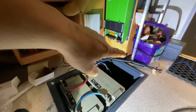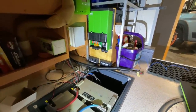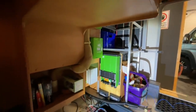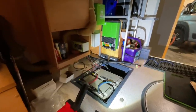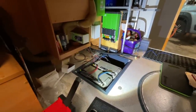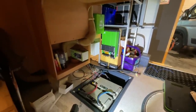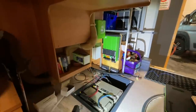All the old stuff flies out. You can see we've already pulled all the new cables through — for the inverter, so we have the new cable routing in place. Then the booster needs to go down through to the alternator and starter batteries. Then the solar controller, because we're building a completely new solar system on the roof. We've decided to do something really good for the customer: he gets 350 watts on the back of the roof. That'll be really great — with proper MPPT controllers, so he really gets maximum enjoyment and the two lithium batteries get properly filled. And then he can of course use the well-dimensioned inverter — the 2060 — for all the onboard sockets.